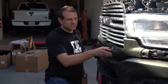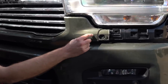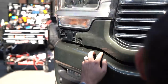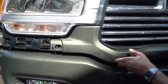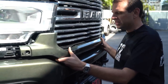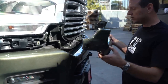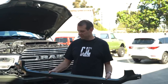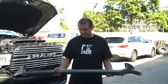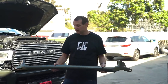To remove the lower plastic grill surround piece, it's going to require removing four 10mm nuts. The first one is located right back here, and there is one on either side. Be careful after you remove these nuts when you go to pull this piece out, as there are some locating tabs we want to make sure not to damage. Also, the center nuts you'll have to get to from underneath the truck. We typically recommend buying the pre-primer pieces rather than trying to paint the chrome pieces, because the paint tends to flake off once you paint over chrome.